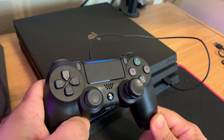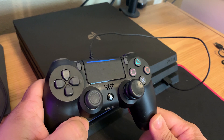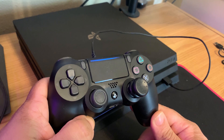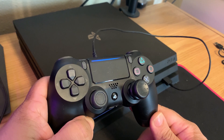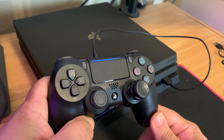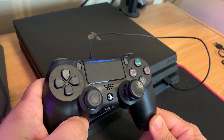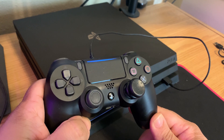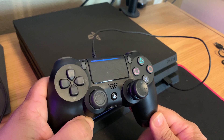If you're having problems not being able to see your PS4 on your screen — a black screen on your TV or monitor — here are a few things to try. First, disconnect and then reconnect the HDMI cable and see if that works. Next, while the PS4 is on, try unplugging your TV from the wall and then plugging it back in. Surprisingly, this seems to work for a lot of people, so definitely give that a try.